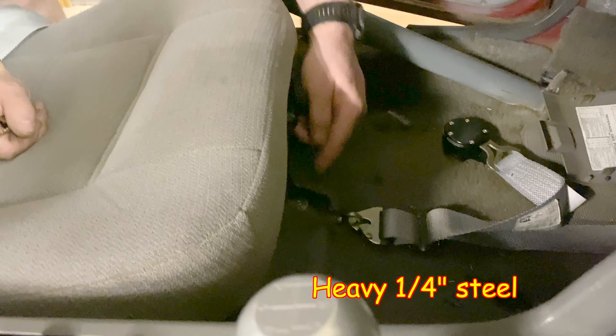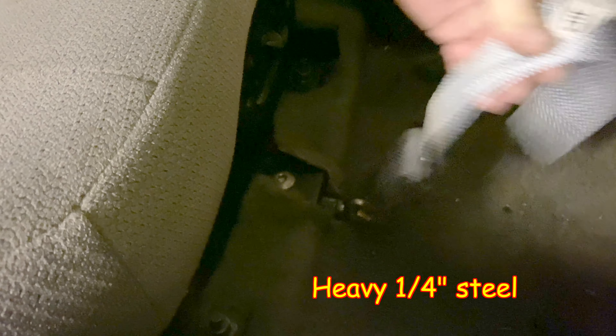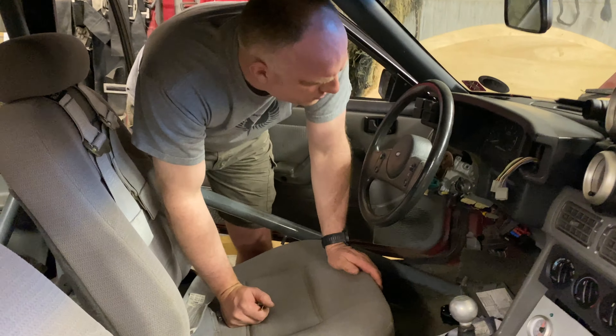Since he's got the five-point harness, we needed to change things up. He had the eyelet screwed straight down into here, and that wouldn't work because as soon as you move the seat forward it would hit that eyelet. So I had to make a bracket to bolt in there that moved it down 90 degrees, so we could put that end in there and have the clearance for the seat to move.